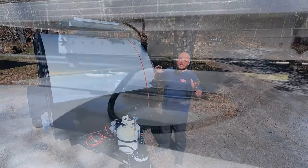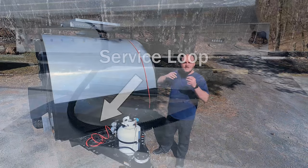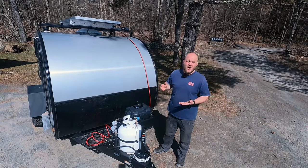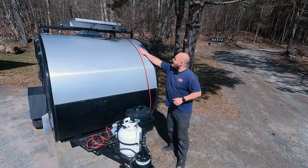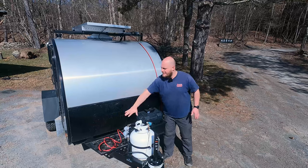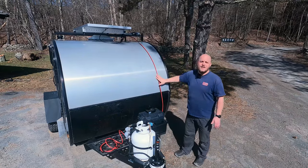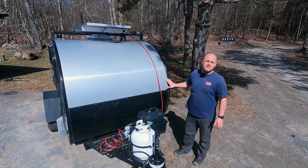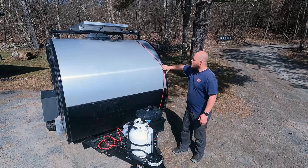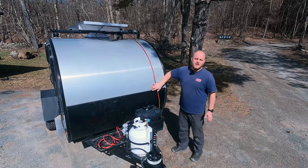This little loop at the top is called a service loop. It allows my panel to tilt, and it also lets me repair those plugs in the future if I have to swap something out. I keep it away from this side — I could have come down the middle, but I have a little storage container there. Coming down over here also keeps it away from this seam, which is a service item I need to be able to repair. So it might look better over in the middle, but in the long run this is the better place to route it.